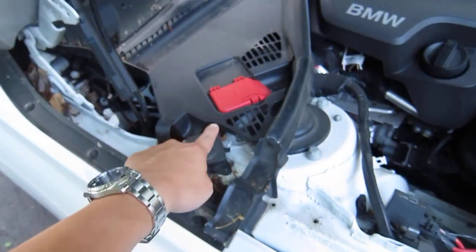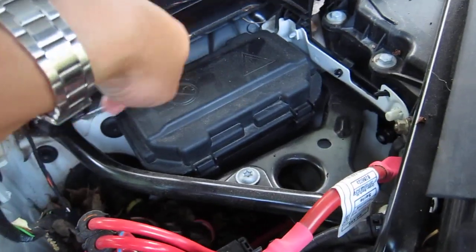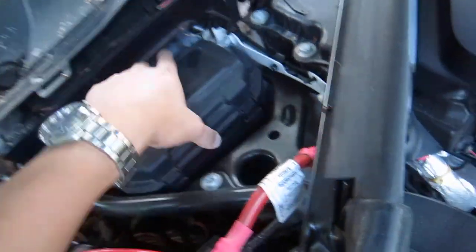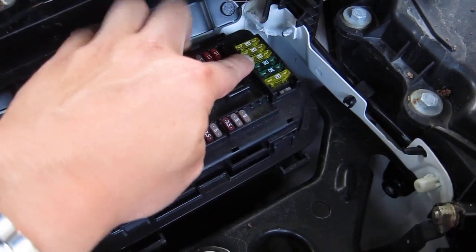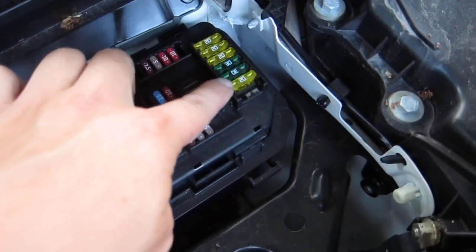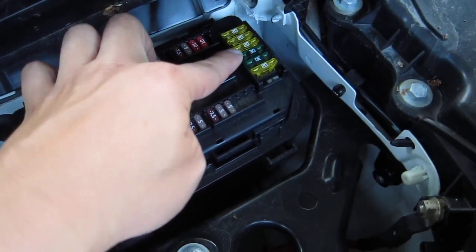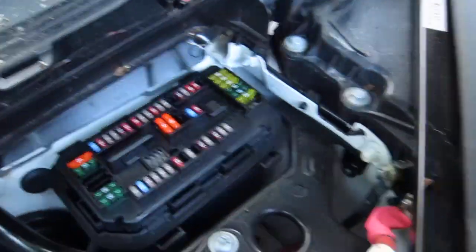Once I popped the hood, there's a fuse box right here under this unit. There's a little lever — just lift the whole plastic piece out. There are little notches in the front and back; push them together and lift, and it should come out pretty easily. Fuse 66 is this yellow one — 20 amp. And 68 is this one, also 20 amp. The third one down on the right-hand side is the one linked to the console's cigarette lighter adapter.